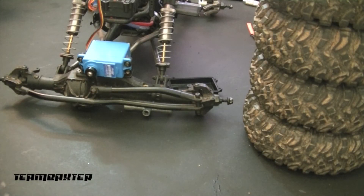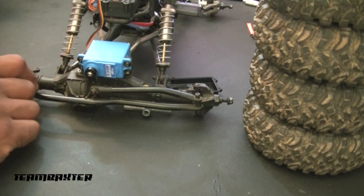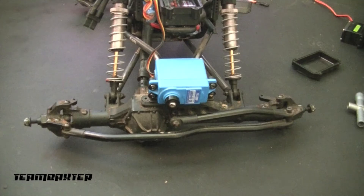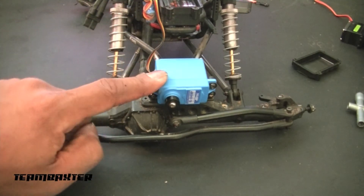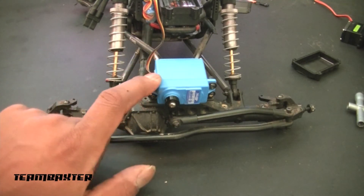It's well past time for maintenance on the AX-10. The rear servo has died on me again, so I need to replace it, and while I'm doing that I'm going to fix a few other things wrong with this. I've been using Hitec waterproof servos, HS5646WP. I use these on several vehicles — both dual steering and regular single steering — and the regular single steering varieties never die, but on the rear steering ones, only the rear steering servo dies.